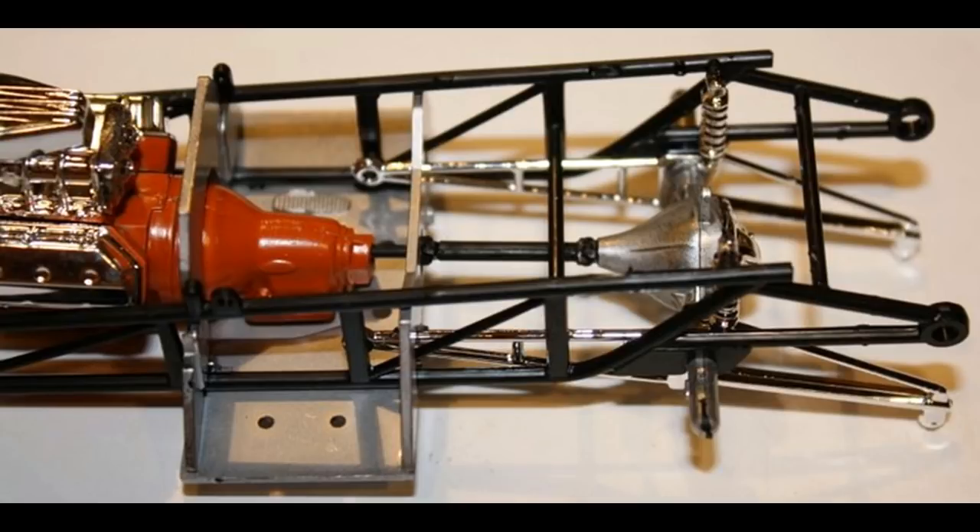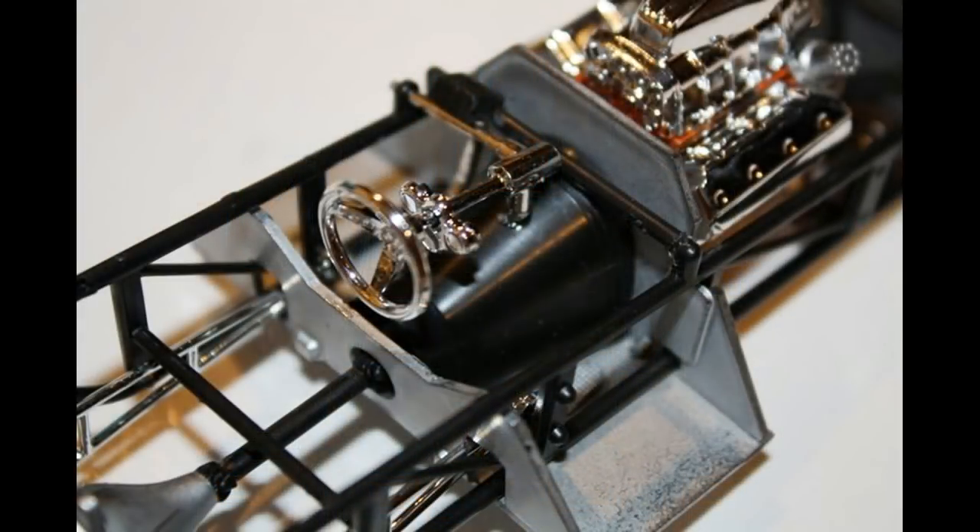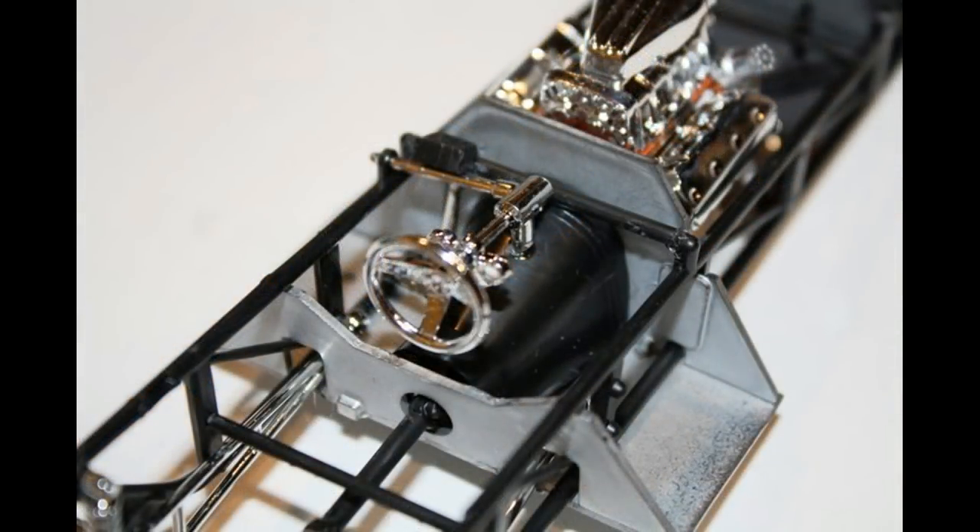First, the floorboard panel was slid through the chassis's upper and lower side rails to the lower underside panel. Then the rear end and drive shaft, previously assembled, were pushed into position — there are really clear location points so they lined up nicely and fit perfectly. The floorboard must go in first so that the drive shaft can slide through the hole in it. Next, put the floor pan and the firewall into place, and the transmission tunnel needs to be pieced together. After that, the steering wheel and column went in without any problems.